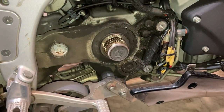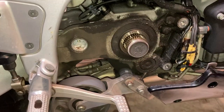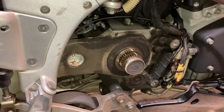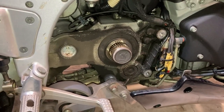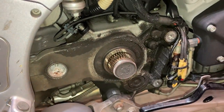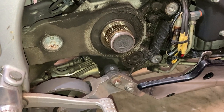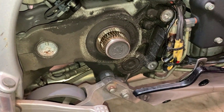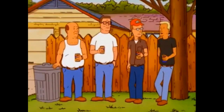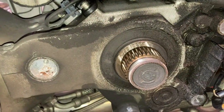I had to remove the front pulley sprocket, and thought, might as well do it now while I've got something to hold everything still. I pressed on the brake and started out with my breaker bar — but I was too weak to do it. I phoned a friend and he said they put red Loctite on these. So I applied some heat and tried the breaker bar again — still couldn't get it. Applied more heat, still couldn't get it. Applied a whole lot of heat until the thing was smoking, then pulled out the impact. Man, I'll tell you what — got it pulled off. There's the nut to prove it.